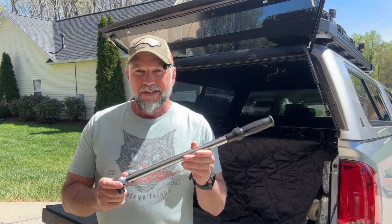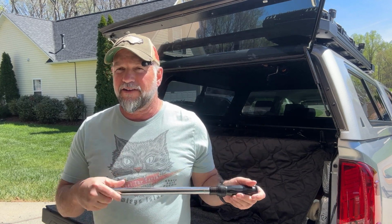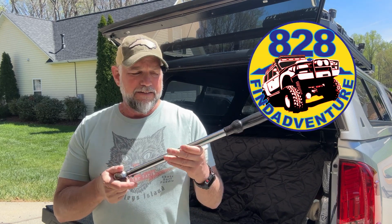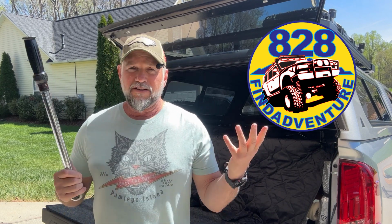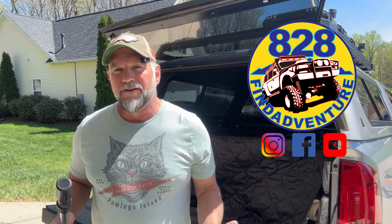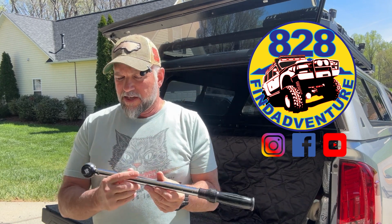Alrighty. Well, guys, I hope you like my little short video on the torque wrenches. I think everyone should keep something like this in their car, at least a breaker bar, so you have some leverage to get those hot lug nuts off and put them back on tight. It's very important. Nobody wants a wheel to fly off. We've all seen the videos of wheels coming off vehicles. Sometimes it's because the lug nuts weren't put back on tight. Sometimes it's because you got a spacer and negative offset wheel, and physics snaps it off, and the wheel goes flying down the highway. But anyways, I think everyone should carry one of these.